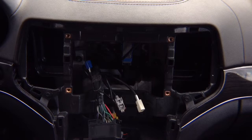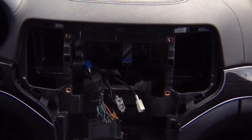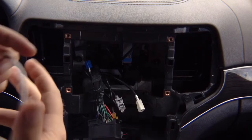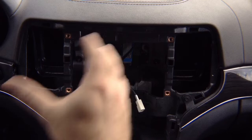Now you want to route your USB cable. You can buy any cable — if you're just installing Apple CarPlay or Android Auto, use a long cable like this. Route the cable through inside the dashboard into your armrest. You can use a dedicated iPhone cable or a regular USB-to-USB to plug in any phone. The best location is routed behind the panels into the armrest for a factory look and feel.